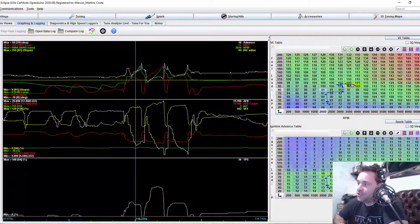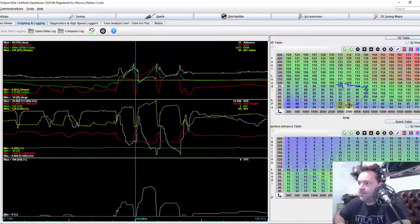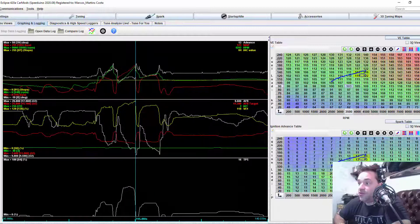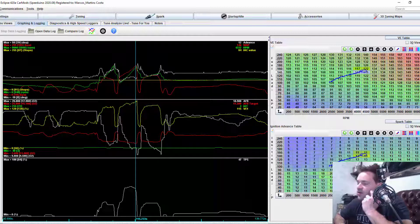Keeping going — probably first gear, just testing. My foot is off so I can't count much. But here again, you see it's a little rich — very rich right here. At 113 kPa, those lines are between 10 and 9, and it was supposed to be 11.7. So that's a point where we need to look at.